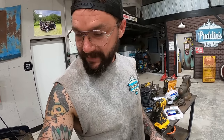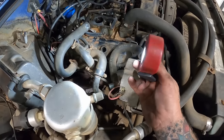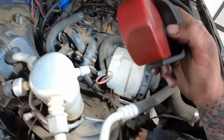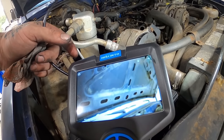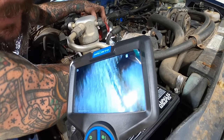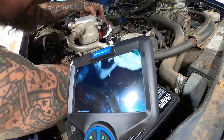So I'm hoping, I'm not hoping for a leak, but obviously something's leaking. So I'm hoping it's something simple, maybe like a valve cover leaking. Now I would just simply look, except the tube runs to the valve, and then there's the performance coil right in the way. So you really can't see much of what's going on down in there. So once again, we're gonna use our little cheating camera. There's the oily hole. So there's our head. There's our valve cover, I do believe. So if I was a betting man, we just got a leaking valve cover gasket.